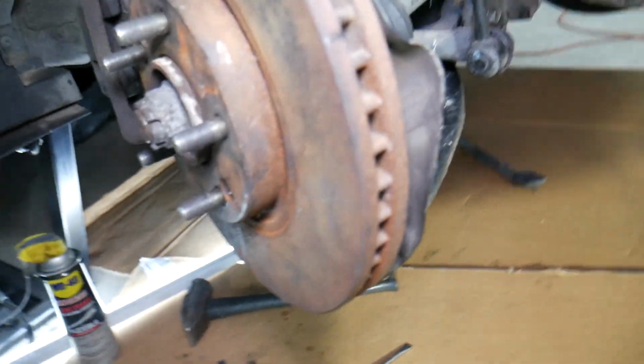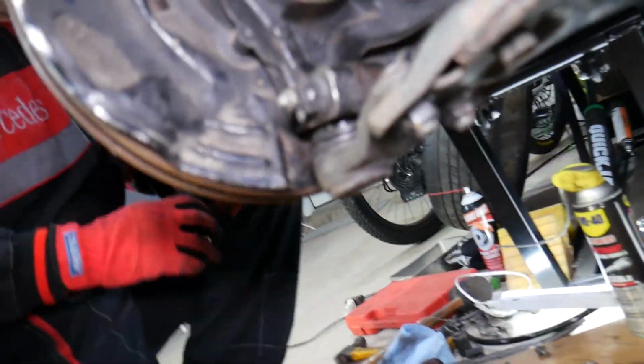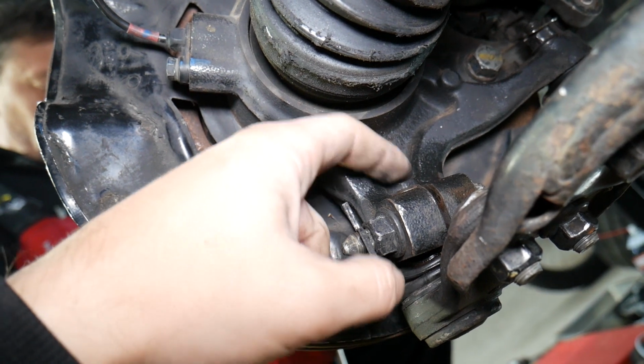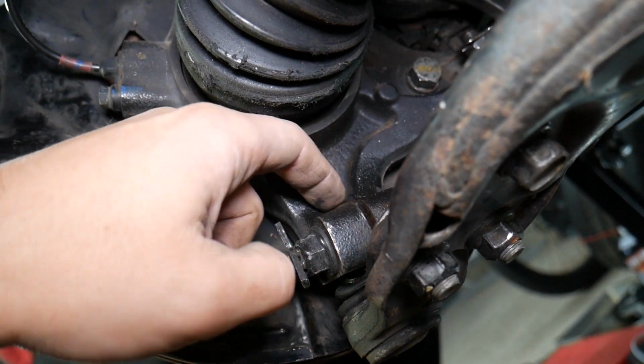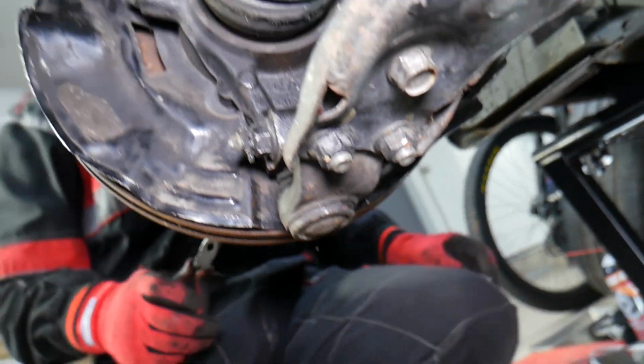Next step, we'll need to pre-loosen the bolts right here. Let me go underneath so I can clearly show you what to do. This is the ball joint. In most cases on cars, the ball joint may have a nut or bolt on top or sideways. If it's sideways, they will be cut like that so you can spray penetrating spray and let it soak. We already did ours. This is the spray right here. It's amazing. We'll put the link in the description of the video below.